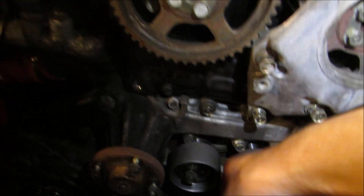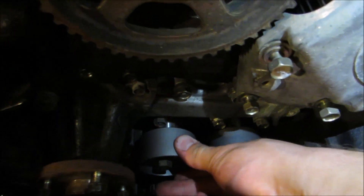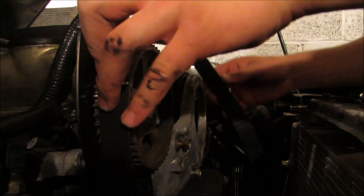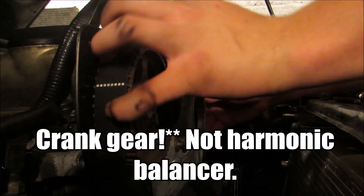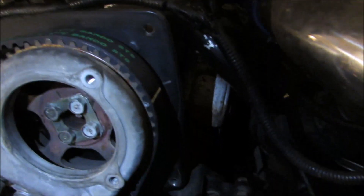So I put the new pulleys on there. You just want to make sure that you have it going the right way so that it actually provides tension - see the way it springs back. Grease them up. Now we're just going to throw on the new timing belt. You want to make sure that you put the little marking on each designated tooth on each cam gear as well as the harmonic balancer on the bottom. It is a little tricky to set right, so be careful and make sure they're all where they need to be.